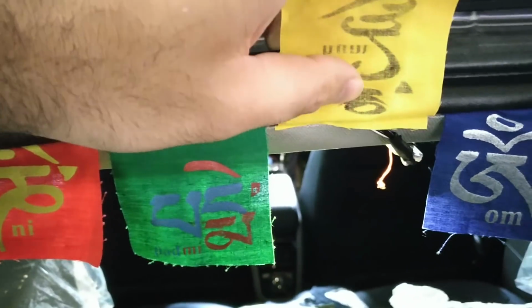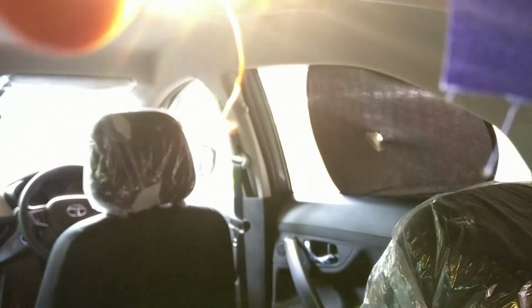So what I've done for the rear roof lamp is run a wire through the beading. So you need about 1 meter of wire, dual wiring, so that positive and negative can be carried to it. So all you need to do is just connect it to the LED module and then plug the whole unit through a small window into the rear boot light.